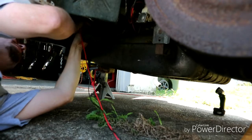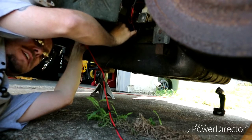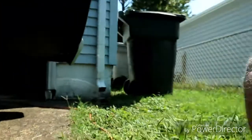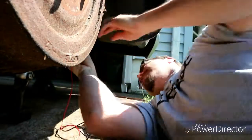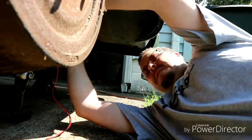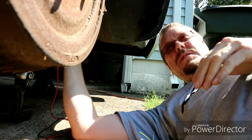What we're going to do is just stab the wire. The voltmeter is reading like 0.05, 0.06 — so no power on that side. Let's go around to the other side and see if there's power on the transfer. That's reading the same thing. So now we're going to go before the joint — and it's reading. Okay.